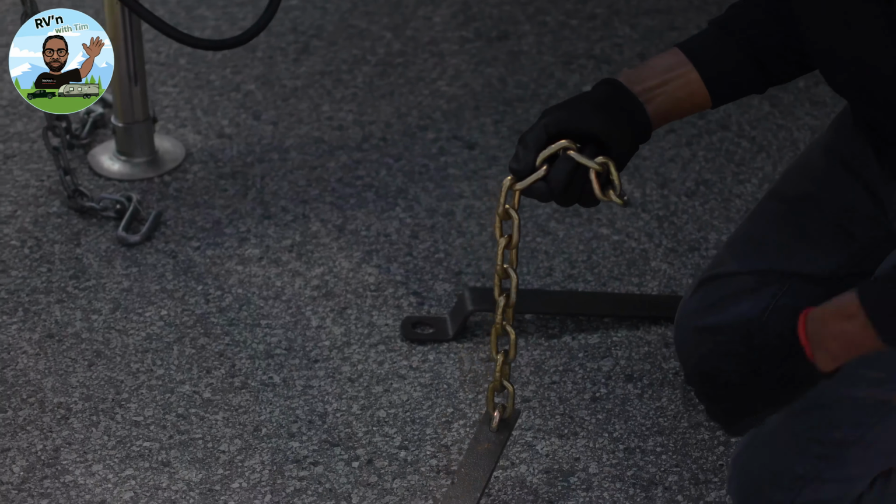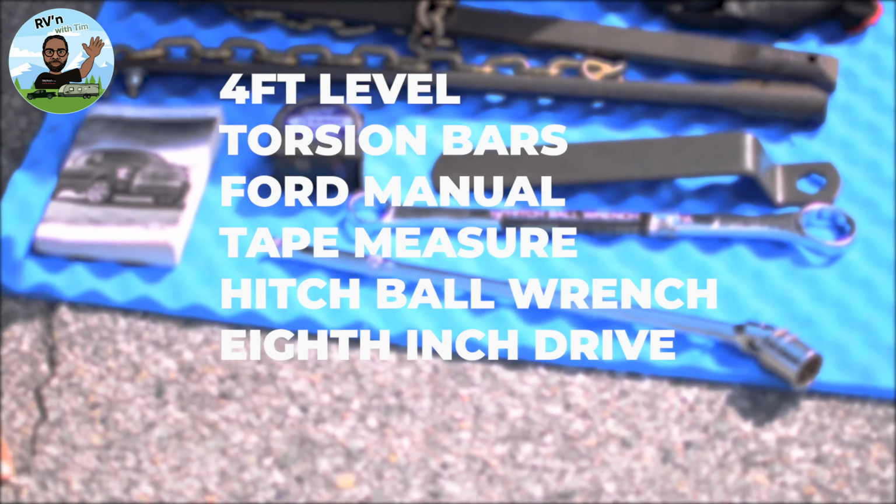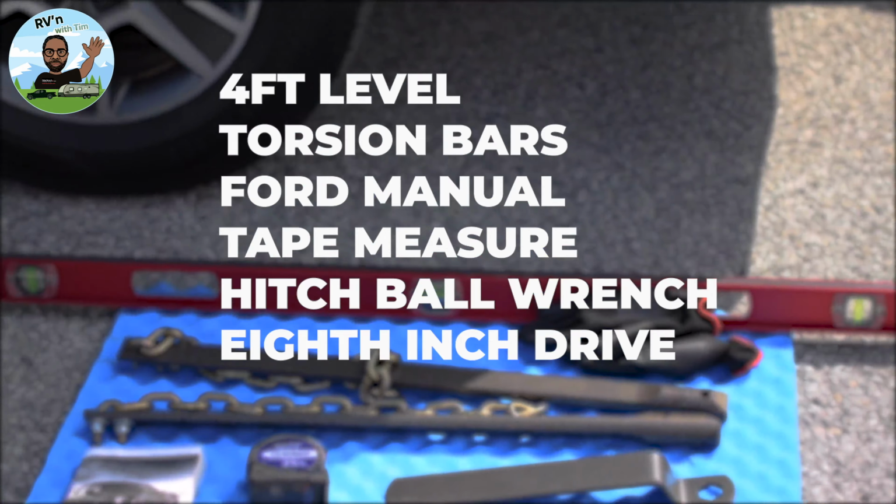The tools we're going to need for today's setup: a 4-foot level, torsion bars for your weight distribution hitch, the Ford manual, and a tape measure. This is the bar used to set up the torsion bars, and this is the 1/8" drive, which is to take off the weight distribution hitch to make adjustments to it.